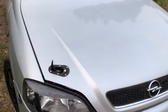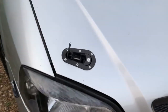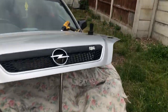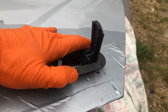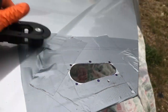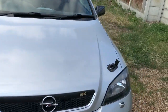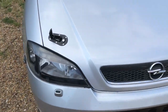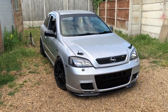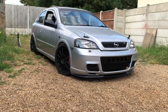One aero catch down - I'm going to get on with the other side now. I've just noticed the headlights have got a little bit of staining, so I've got some 2000, 4000, and 7000 grit paper and I'll scuff that off and get them nice and shiny while I'm at it. The last aero catch fits in there lovely and tight - absolutely no movement, perfect. Both aero catches are fitted, all nice and secure, pins done as well. Now I'm going to sand down these headlights to get them shiny again, then get the car out, get the tracking sorted - it's going to have loads of camber on the front - and I'm going to make a new front splitter as well, really low along the bottom.